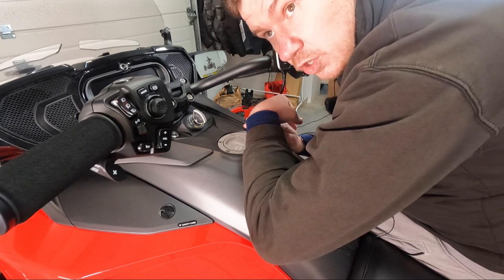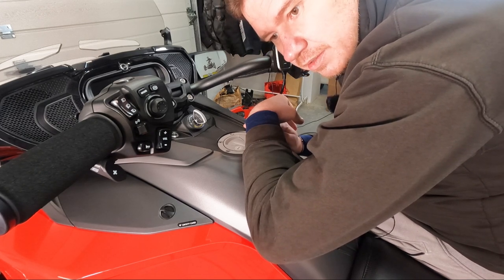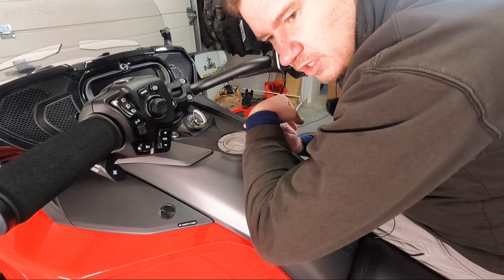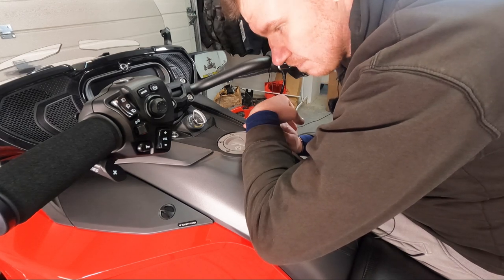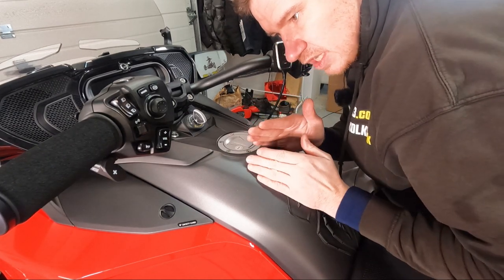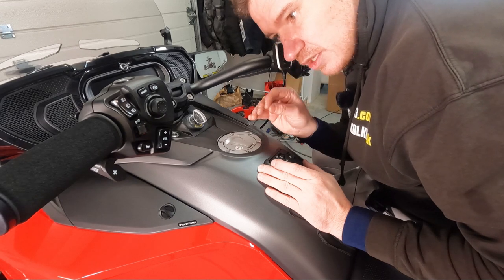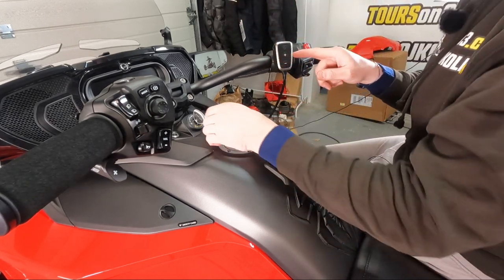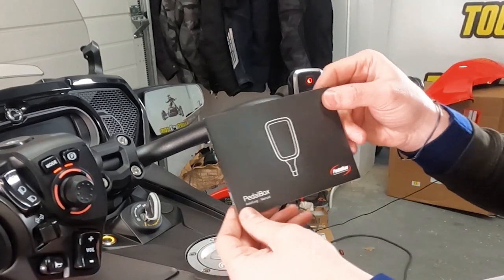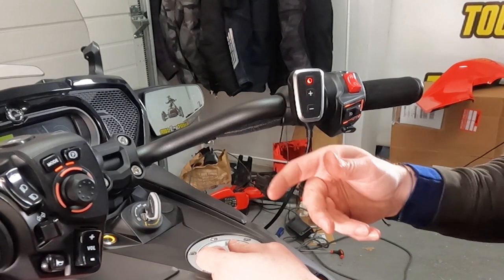Now the most common issue: people plug in the pedal box and go for a ride. The pedal box can work, but in 80% of cases it will shoot error codes — the engine light will go on or even limp home mode. What you need to do — and this is covered in a longer video — you need to learn the signal from your bike, because every bike has a different signal through the throttle cables. You need to pair your pedal box. By the way, everything is written in the box, but yeah, who reads manuals these days?